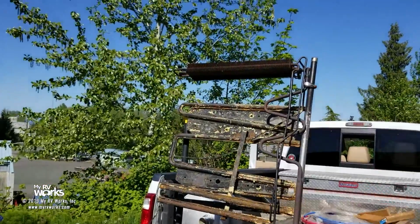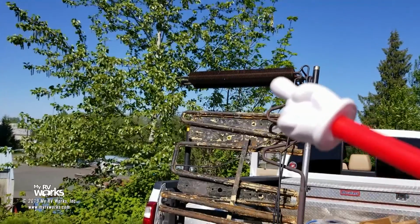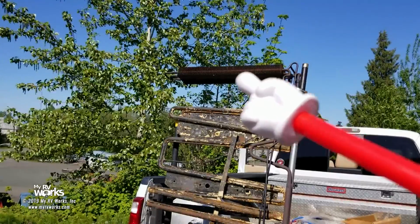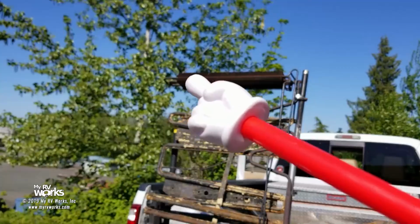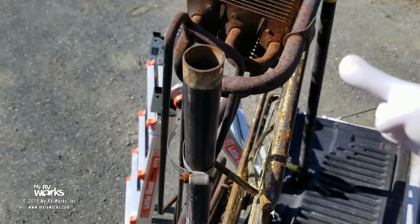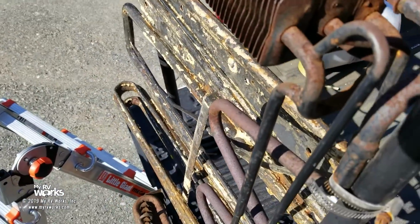So with that, where we left off on our ammonia, we started off as a liquid, made it up here, we've got rid of the water, hopefully, cross our fingers, and now we're going to drop the temperature again, and we're going to turn that ammonia vapor back to a liquid in this condenser. We're going to condense the vapor back to a liquid. So let me climb up on a ladder and shine down inside of that and show you what's going on inside of the condenser. Okay, we've picked up the trail on this tube right here. Let me pan you around here.